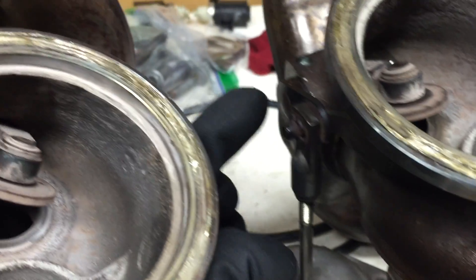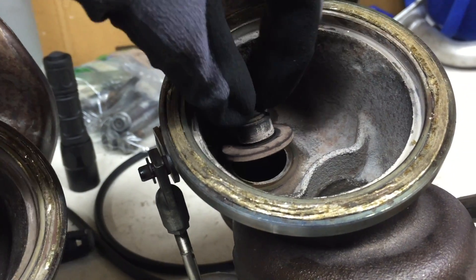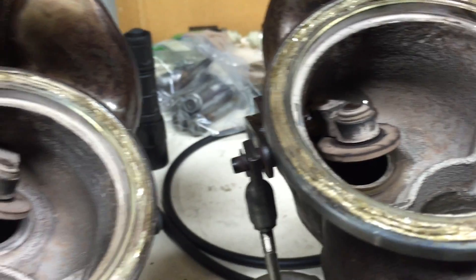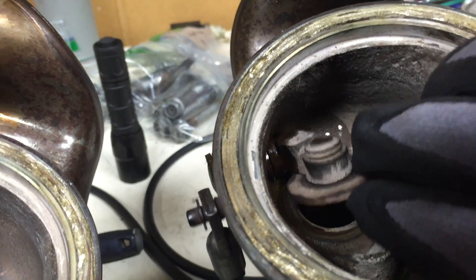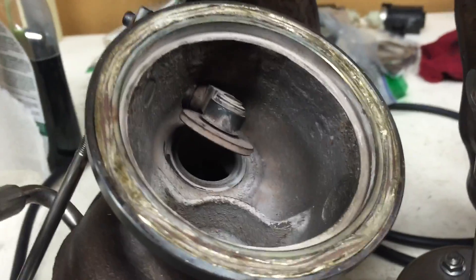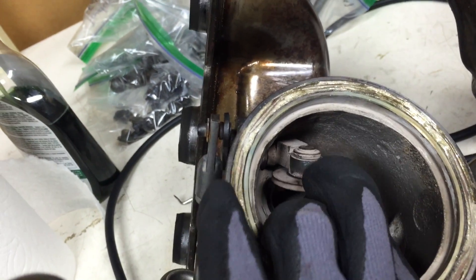Unfortunately, this lever is attached to a rod and the rod moves through the bushing and is attached to the wastegate flapper. The problem is that this system generates play — it wears out. You can see that rather than it being a perfectly axial rotation, the flapper has just a ton of play. Right now the clevis isn't moving at all; this is all just slop in the system. The other turbo is the same way — again, not moving the actuator, strictly slop.